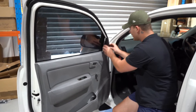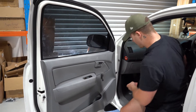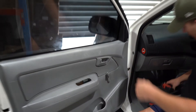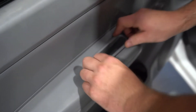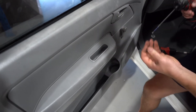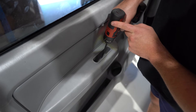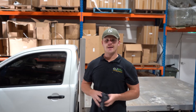The remaining steps are fairly straightforward. We remember our little black part — just bring it in, give it a nice hit. You've got your single clip — smack it in there. Press in the Phillips head screw, and this is your main one — bang it in there nice and tight, it'll hold your door handle firm. Drop in the coin pocket without the screw first so you can confirm it's lining up, then you can use your finger to guide it in. Tighten it up nice and tight so the door feels firm.